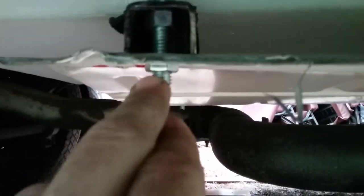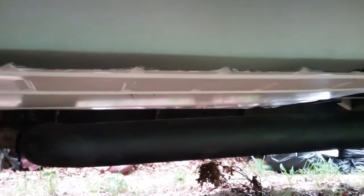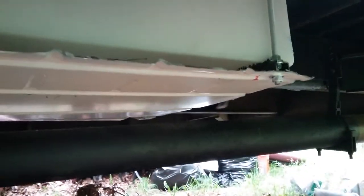You can see the threaded rod comes down and there's a support beam. I left the threaded rods just long enough so I can screw them in on all four. There's the exhaust and it has a nice air gap — nothing touching the tank. So it will get no heat from the exhaust pipe and it'll also protect from rocks and stuff. I'm also going to do another piece that comes down on the backside right here, just in case the tires or mud flaps or something — I don't want anything hitting there. That worked out really good, and that's from the back of the school bus seats — the big seats — it gave me a 33-inch long piece, just the size I needed.